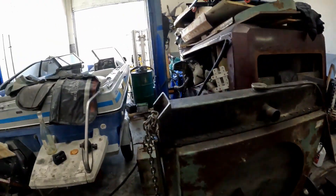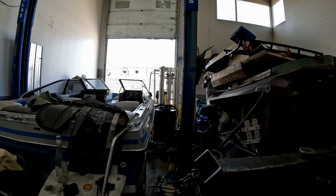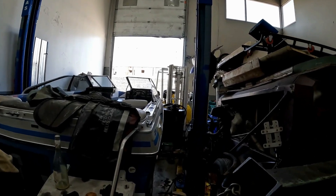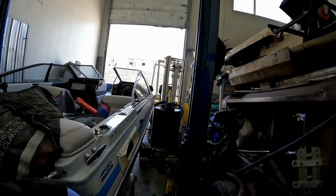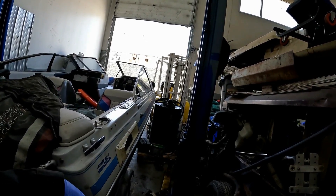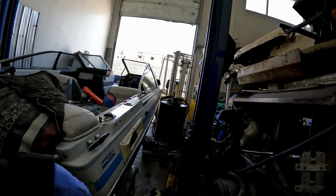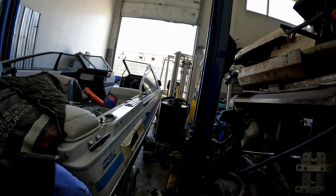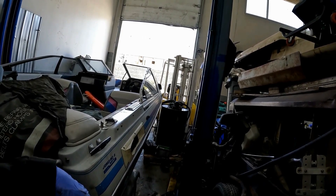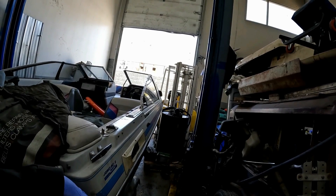I changed the oil on the poor old Buddha here and it's been running really nice, but there was a lot of trash in the oil — it had over 100 hours on it. I didn't plan on running it that long, but with all the other projects I've delayed the engine swap. There was a little bit of brass material in the trash which I wasn't happy seeing. So I took an oil sample and I'll send it off to see how bad it is. I want to get that engine out before any permanent damage is done, because I promised that engine to another person and I don't want to hand them junk.